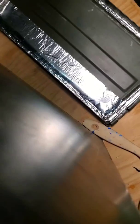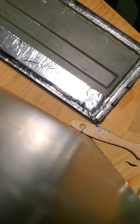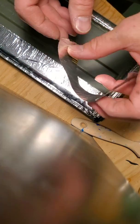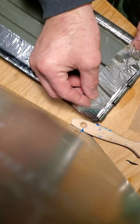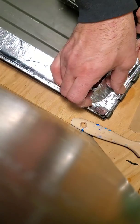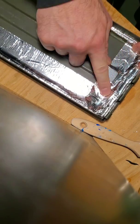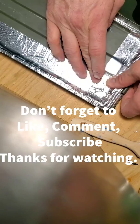I'll show you how I put on one of the side pieces. I just basically measure it and rip it. Be careful with this stuff because it curls really well and it's sticky as hell. Just tuck one edge in, smooth it down, then roll it over from that same edge, and finally stick it down. That way you get enough slack in the gasket where the lid will actually close without ripping the tin foil.